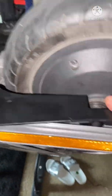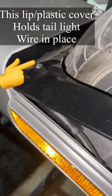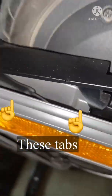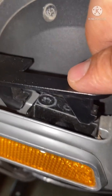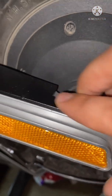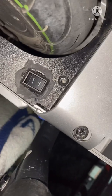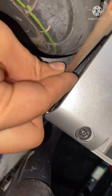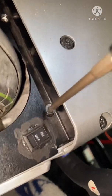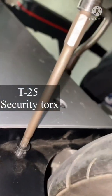Just got it coming through, sitting here, coming out to the side like that. You don't have to worry about that touching the tire or anything. From there, put your back panel on - put this side in first, push down, make sure those tabs go over. Left side push back, get your holes to line up, get your screws in. That's it - scooter's complete.